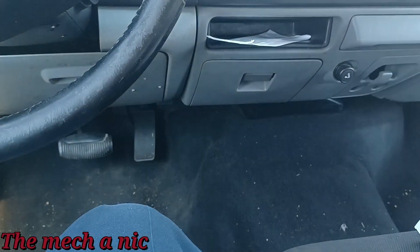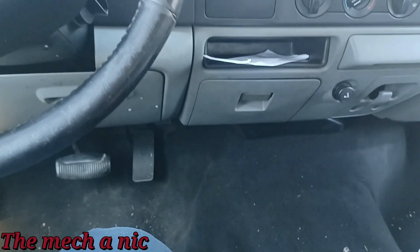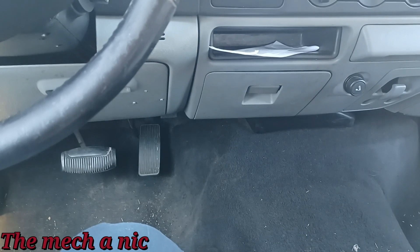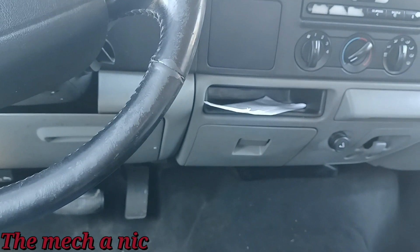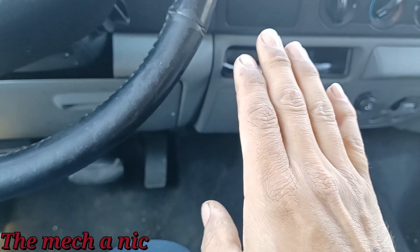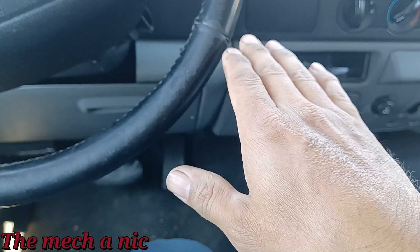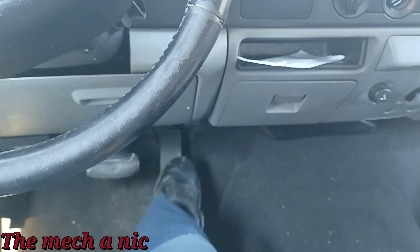While she's out looking for a so-called accelerator pedal, I spent 10 minutes looking at this thing. Using scan data I could immediately rule out that there's nothing wrong with the accelerator pedal. There was a correlation code — I can see how someone would go down that rabbit hole — but the accelerator pedal is fine. The actual problem I'm finding is the throttle body. It's very hard to move and when you actuate it, it's always supposed to spring back to its normal position. This one doesn't — if you move it, it stays exactly where you put it. That's why the car runs at idle but won't respond to the gas pedal.